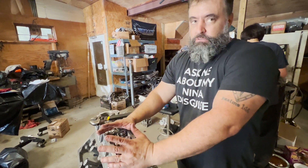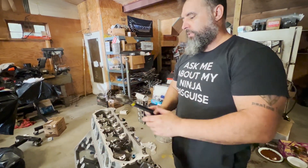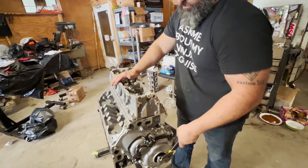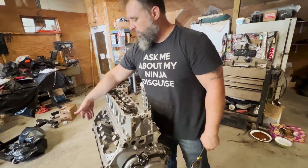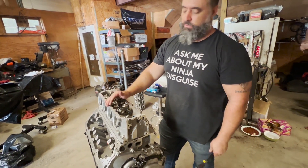When you use clay, you have to get in there, slice it, pull it out, and measure it with a micrometer — all that crap. So I did away with that years ago and just went to this dial indicator method, and we haven't had any issues yet. It's very simple and doesn't take long. We always check it twice, and a lot of times if you really want to be precise you'll check opposite sides of the head to make sure everything's flat.